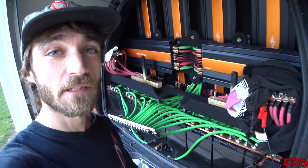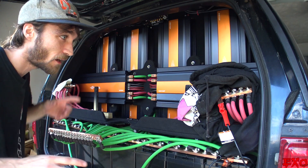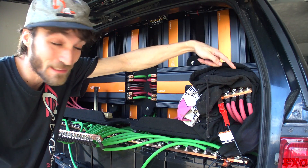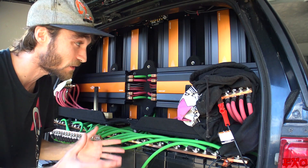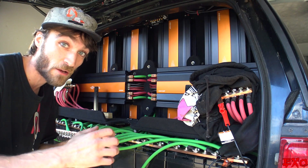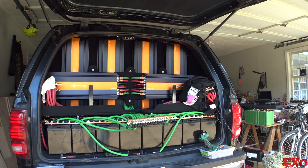When getting started with all this, it's crucial to maintain awareness of these right here, because these are completely energized with our AGM bank beneath it, and there is metal encased around the whole back. Being careful is an understatement — you just kind of have to work around and keep your eyes on everything. So with everything still wrapped up, we can go ahead and grab our lithium.